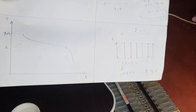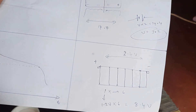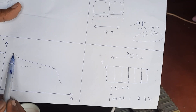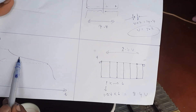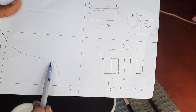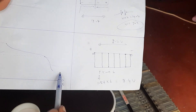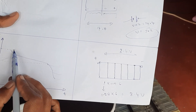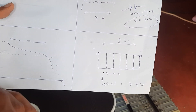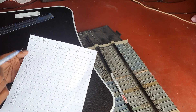Here is the voltage curve of these hybrid battery modules — how the voltage changes with time. Initially starting at 8.4 volts, as time goes on the voltage starts to drop. As you can see there is a sharp drop in the voltage after 6 volts. This is the point — the limit — at which the battery's capacity is basically useless. So let's see how to check the battery modules that I have.